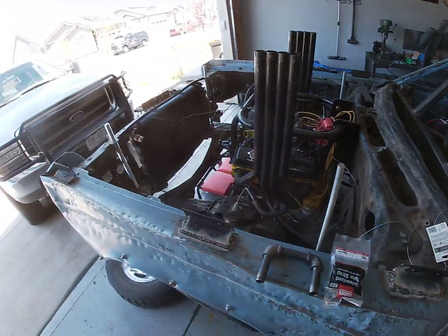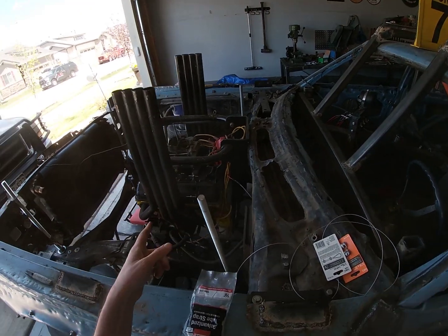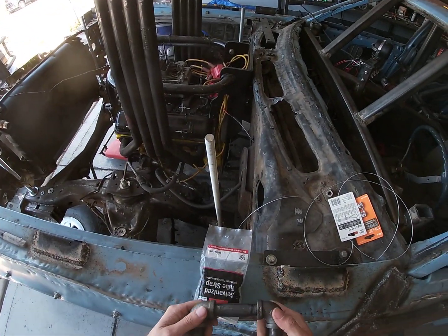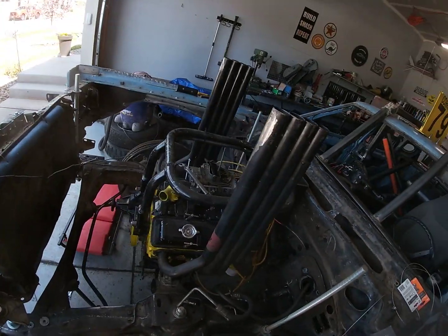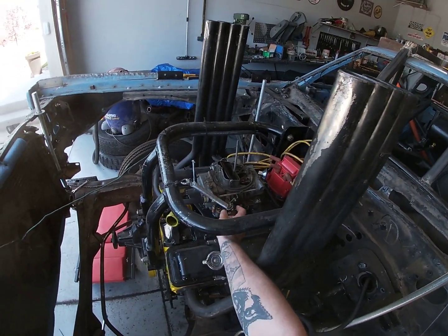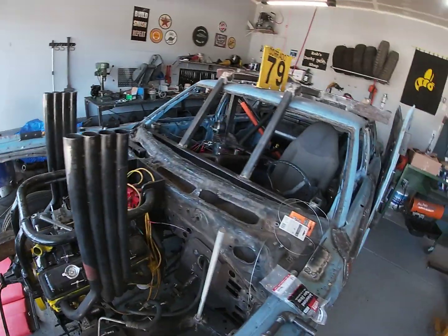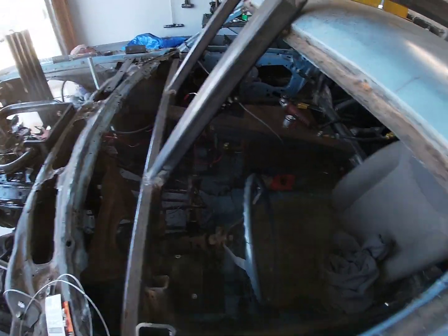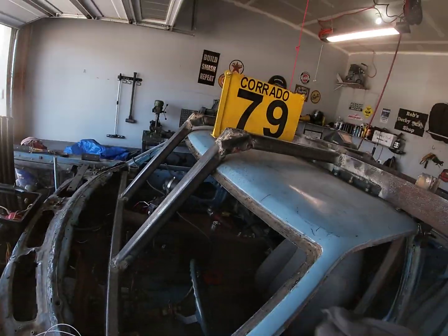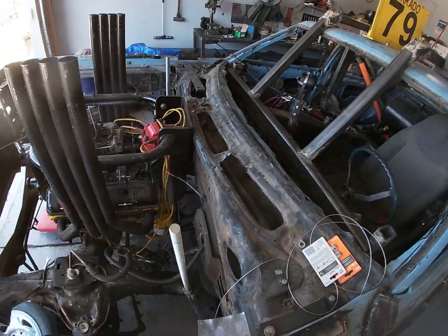The project for today, T-Balls is coming down to help me get the motor fired up. And so what that means is we're gonna need a throttle. Now, you can just push on the throttle yourself. There's a spring here already attached. But if you're in the car and you're troubleshooting stuff, like we probably will be, it's going to be much more handy if we just go ahead and set up the throttle cable.